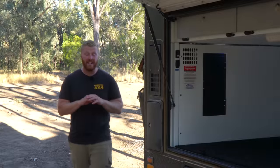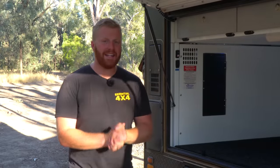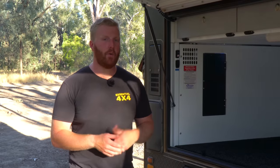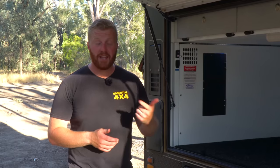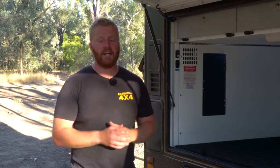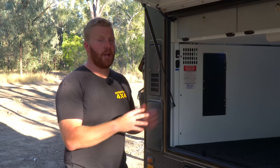Water storage is incredibly important, but the other main factor for off-grid living is, of course, power. This is one of my favourite topics of conversation with this camper. The Lifestyle Recon R4T SE comes standard with one 200-amp-hour battery, a 30-amp 240-volt charger, 30-amp DC charger, and a 50-amp solar controller with two 175-watt solar panels on the roof. This wasn't enough for us and we've upgraded all of that, but before we get into the full details of this electrical system, let's quickly recap what sort of appliances we have drawing from this system.